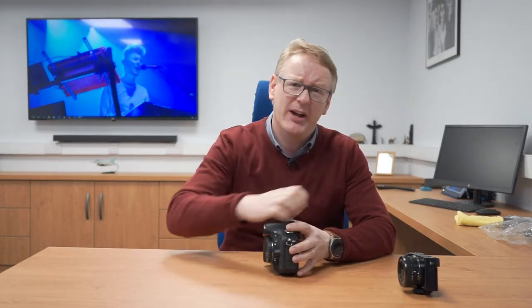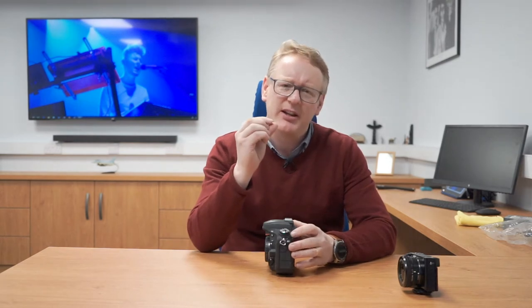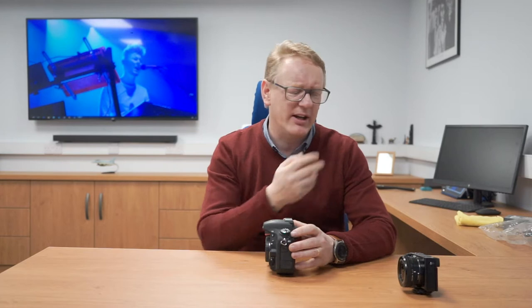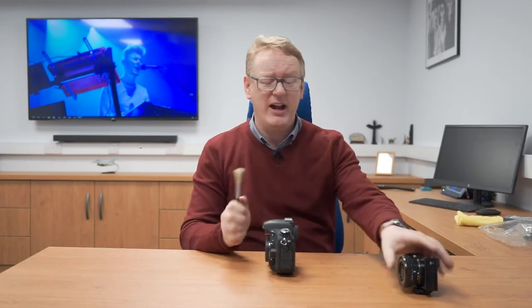Sand is a killer. As I said in a previous video, sand is very small rocks, and you wouldn't take a rock and rub it on your camera. But we get sand in there all the time, and if you get sand in a switch or in a dial — in between the actual dial on a camera — you can hear and feel it grinding. You want to get rid of that, and a paintbrush is the perfect tool for that on any camera, whether it's a DSLR or a mirrorless.